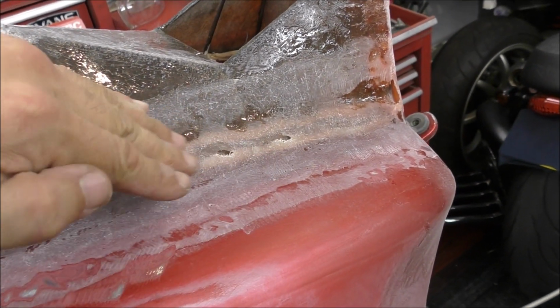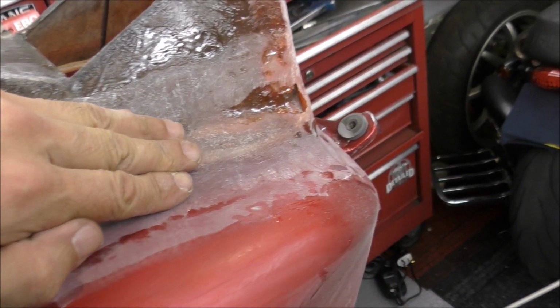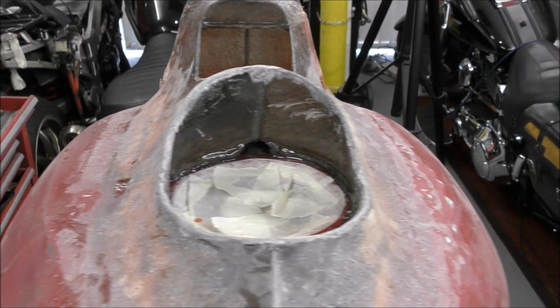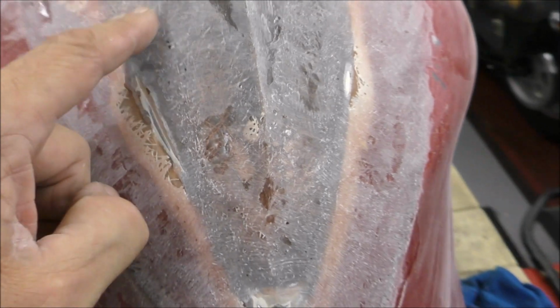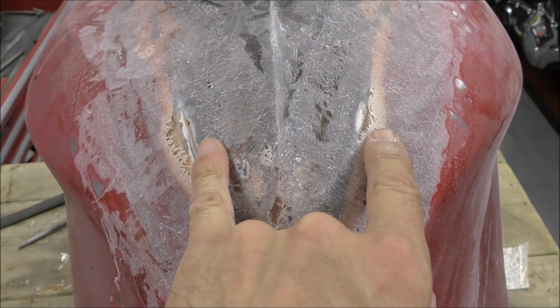Great thing is, because the sanding wheel is circular, you can put it in there and angle it to the right place, and you can just work it down there like that, and it cuts the perfect curve. So almost I've got the shape, and that's purely in one layer of fiberglass. You know, the least materials possible. Got a bit of repair to do where I've gone through. Obviously this metal edge here and here were proud, so just ground those down.